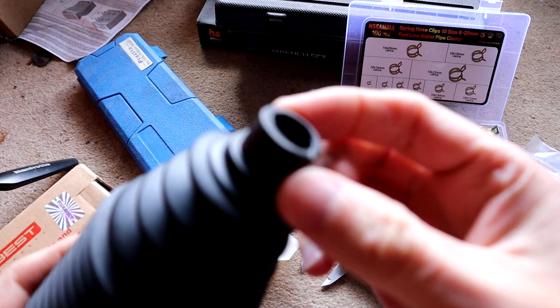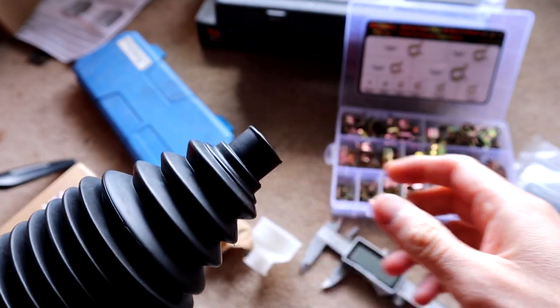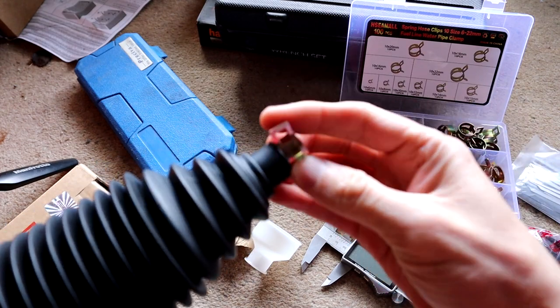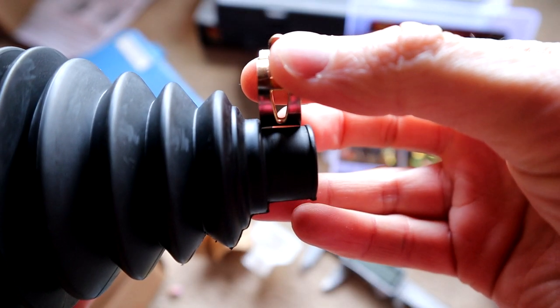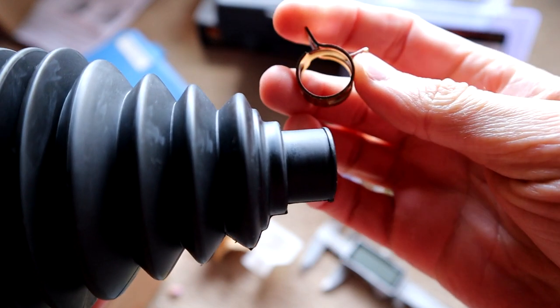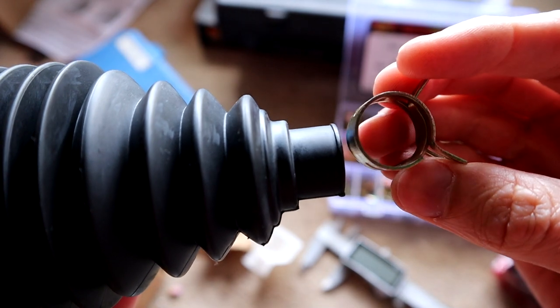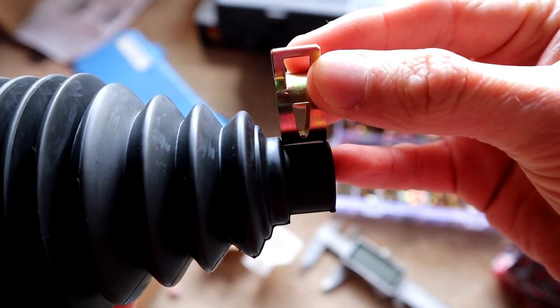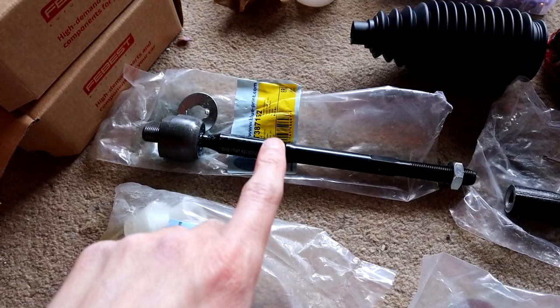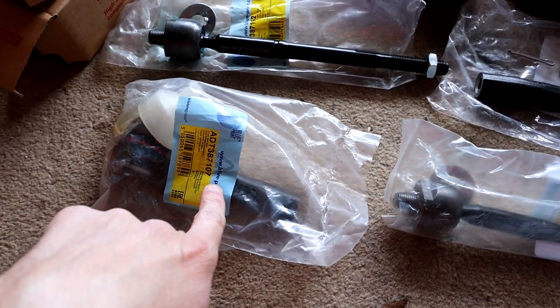So I've just realized that this is about 18 millimeters and the clip here is 16. So we're going to have to try and squeeze it on. The reason being is because the thickness of this clip fits inside this little gap for the 16mm one, and the 18mm one doesn't fit in the gap. So we're going to have to squeeze that 16 on there. Hopefully it'll fit. They're all Blueprint parts. I'll put all the part numbers in the description.